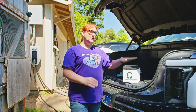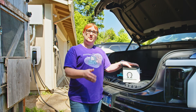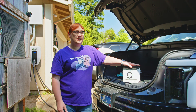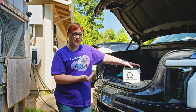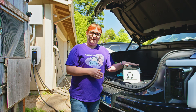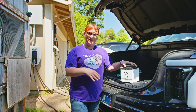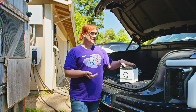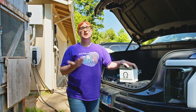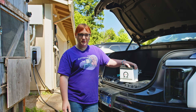This battery was damaged by the 12-volt battery management system in the truck, and I've spoken to other F-150 Lightning owners who've had premature 12-volt battery deaths. Now that the issue has been fixed with a software update, hopefully it won't be a problem further down the line. After we got the battery back from the dealership I tried connecting a charger and the battery started getting very hot, which tells me the internal structure of this battery has met its maker and is no longer safe to use. Being a lithium-based battery, I can't just take this to a conventional battery recycling specialist, so I'll be reaching out to OMU about proper disposal.